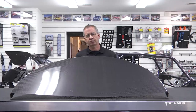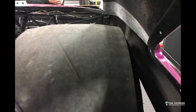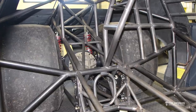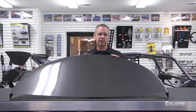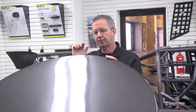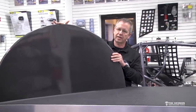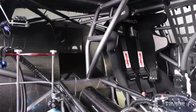A common question is how much clearance do you need when you set it up in the chassis. For a standard 34.5-tire Pro Mod car using this 47-inch tub, we're going to set this up at about 39 inches from the track surface to the top of the tub. When we put this in the chassis, from the track surface it's going to be about 39 inches here — that'll give us enough clearance for the tire to grow and not rub on the tub.